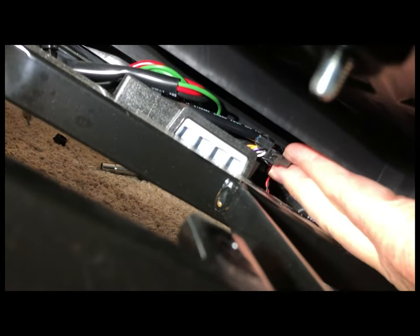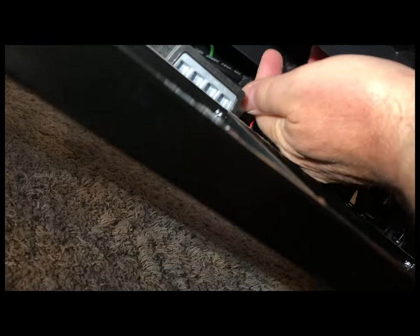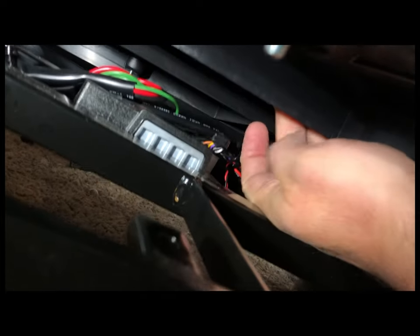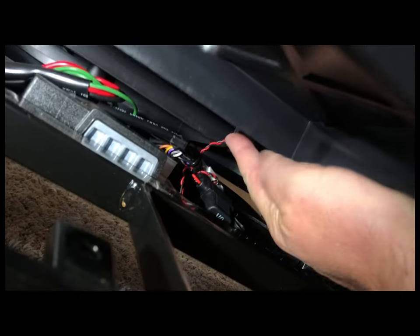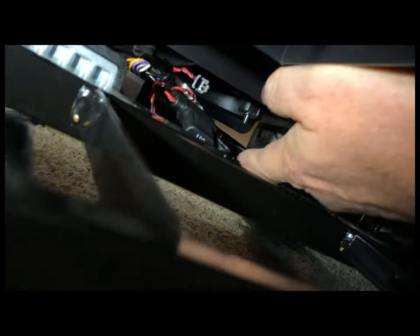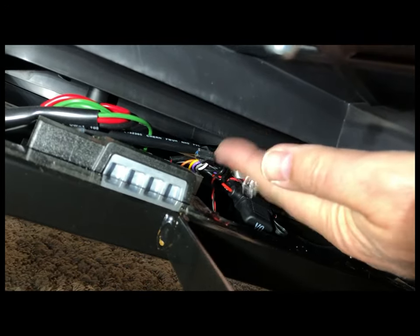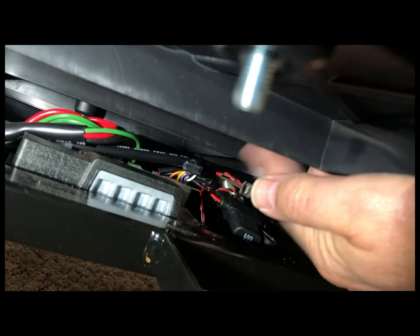Come around to the right side. You're not really taking this plate all the way off — you just need to lift it up high enough to get to the harness there. You can see this would have been plugged in right here, so you can easily get your hand in. This will come up high enough to where you can get in and disconnect the speaker wire down below. It's pretty obvious which one it is — there's nothing else that has those two color wires right there.